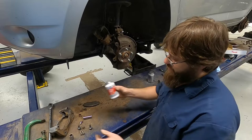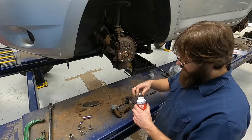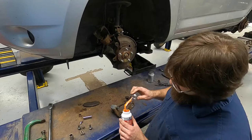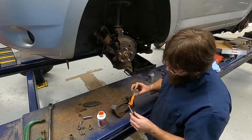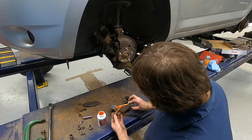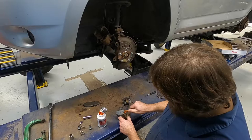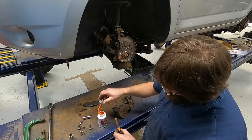We're going to move on to the brake lubricant first. We're going to use it to lubricate the pin as it slides in and out of the caliper. This comes in different styles — I've personally never used this orange before today, but it should be fine. We'll use a little bit of our brake caliper lubricant, dress the pin up real nice in that, take a little bit extra, and put it down inside of there. Now if you put too much lubricant in, it will actually cause the pin — you can see it kind of doing that — it will cause the pin to bounce back out. We don't want that to happen.